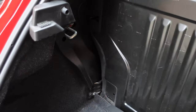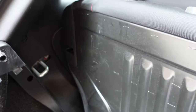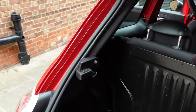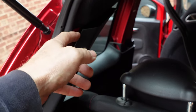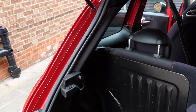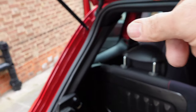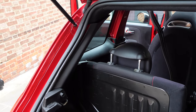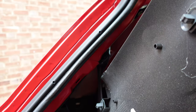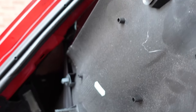Around the back of the car, all we need to do is undo two screws — a Phillips screw under there and another screw just there. Put the seat back forward a little bit and undo those screws. This piece is held on by poppers and is already coming off a little bit. It doesn't need to come off completely because the seat belt is threaded through it; it just needs to be released so we can drop down and release the back of that side panel. Just release it on its poppers and leave it lying in the back — don't need to remove it at all.